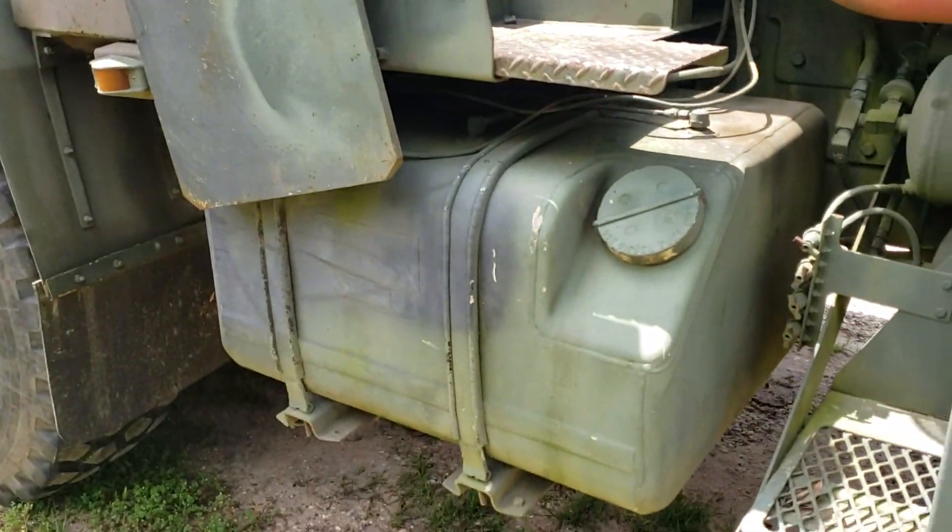Like, if you find a 5-ton tank, they have 75 to 80-gallon tanks — they're too long to go right here and the filler is on the wrong side. If you find a 9-31 tank, the smaller tank, or a 9-36 tank, they'll probably go on there. Some of the LMTV tanks will go on and fit in the same space, but the big 80-gallon tanks are too long.